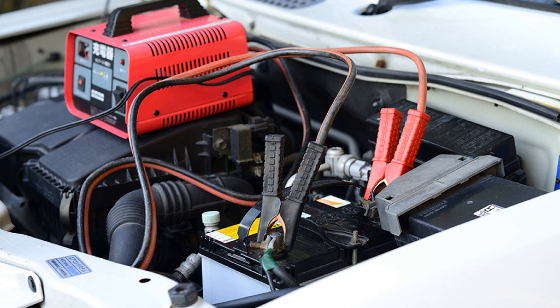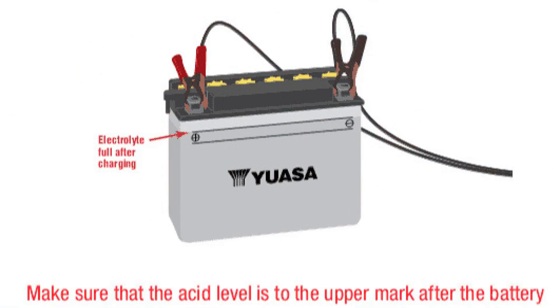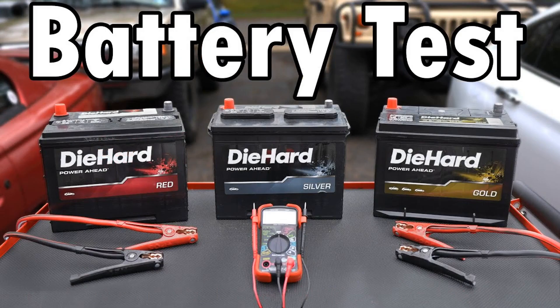In conclusion, we can't say anything bad about this type of battery, as it outperforms its rivals in many ways and is in line with new trends. Quietly buy cars with such batteries and save your time. Leave your comments and suggestions below — we would love to hear your opinions. Properly charging maintenance-free car batteries is essential for ensuring their longevity and optimal performance. Always use a compatible charger, follow the manufacturer's guidelines for voltage and charging time, monitor the process, and avoid overcharging, as this can lead to damage. Thank you for watching, and drive safely.